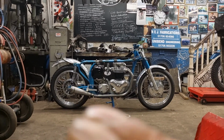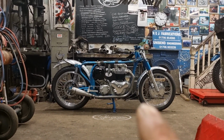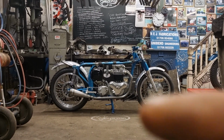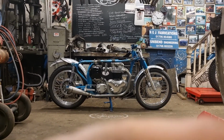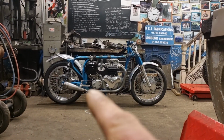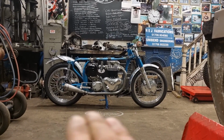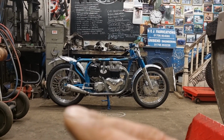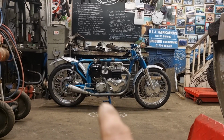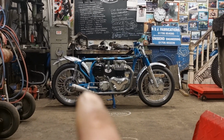Then that almost follows the bottom rail, but it's not. It's sat up ever so slightly, parallel with the floor. If you look, both tyres are sat on the floor, and that pipe is parallel with the floor. If you took that pipe away, the frame is actually sat like that, angled down at the back, so instead of following the rail, I've followed the floor. And then, as the customer requested, get them kicked up as far as possible and as short as possible. Well, that's as far as they'll go in because that peg's in the way.